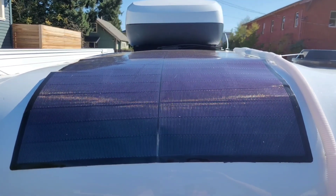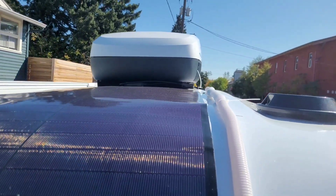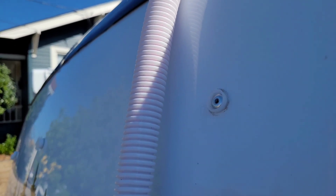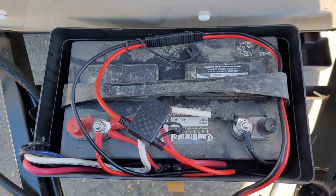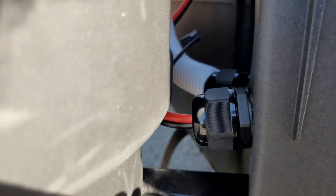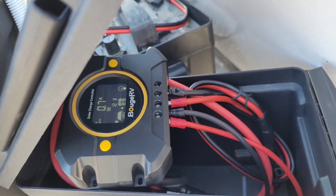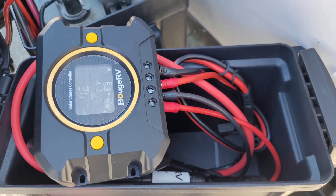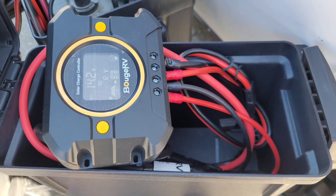Everything is secured and adhered. I'm going to give you a look at my entire setup, and everything I use will be linked in the description below. Starting with the Bougerv solar panel, their extension cord which is protected and adhered with these little 3M adhesive cables, coming on down to the battery. We've got the iGreely connector with the SAE connection and the fuse to protect the battery. All my cables are entering through these cable glands here that I adhered to the back of this box. Inside the box is the charge controller and all my connections. I can now unplug the solar panel when the trailer's fully charged and plug it directly into my portable power station to charge that when my trailer battery's topped off — so it's kind of a two-for-one with this extra step.